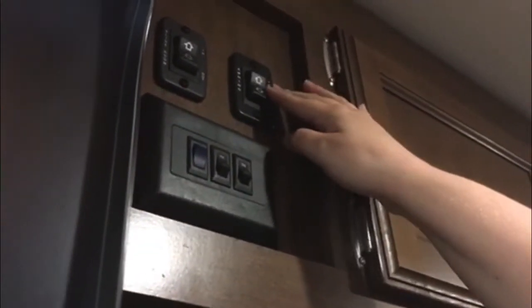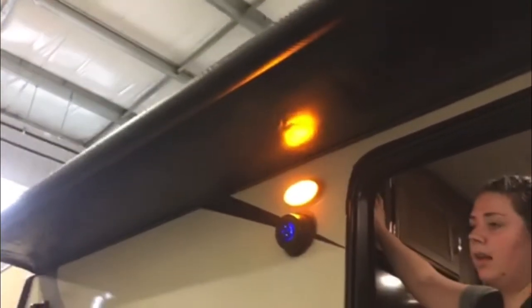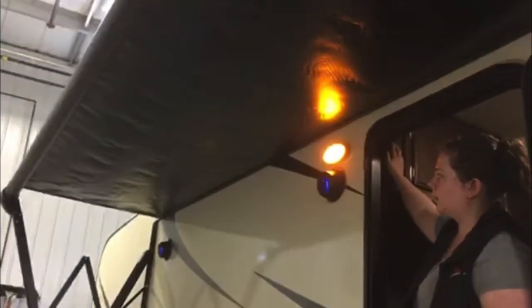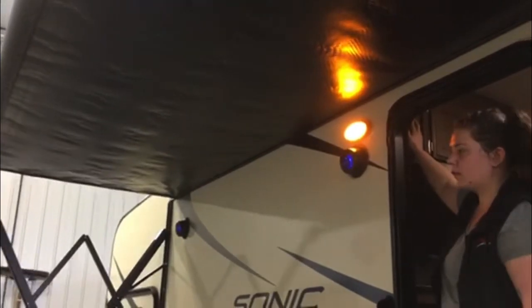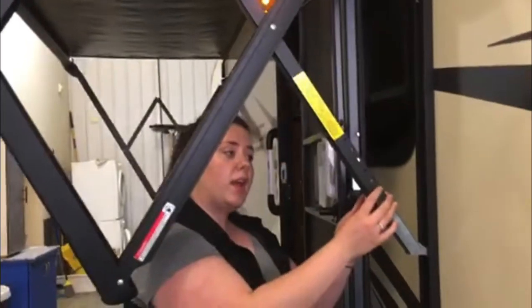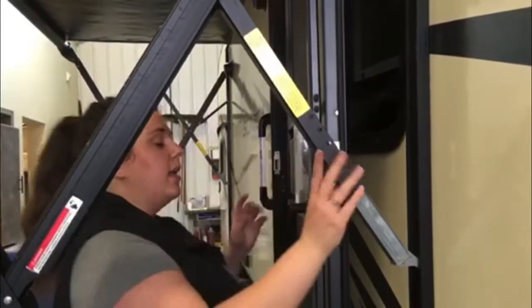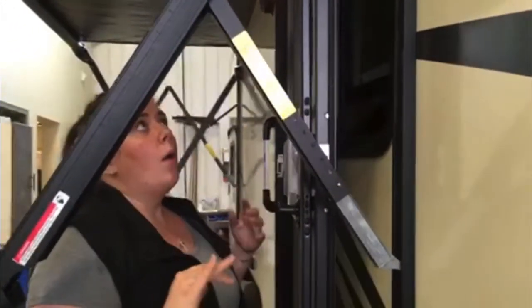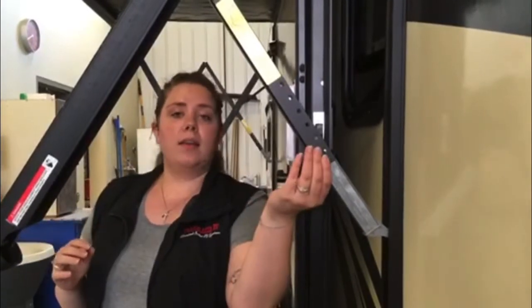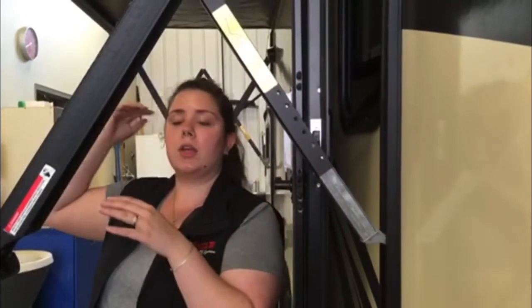This blue light turns on the lights on the awning roller. I'll start to bring out the awning a little bit — we're in a bit of a tight space, so this demonstrates that the awning doesn't always have to be fully pulled out. With these buttons here you can actually adjust the height of your awning — it's adjustable on both sides independently. While the awning is recommended more for sun and not so much for rain, if you do have a light rain and don't want to bring it in, we definitely recommend lowering one side just a little bit to ensure the rain runs off.